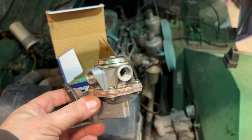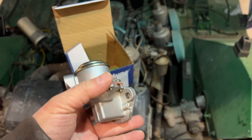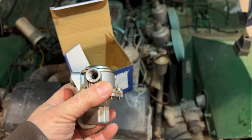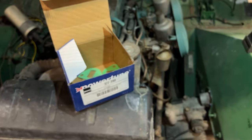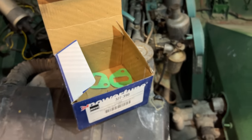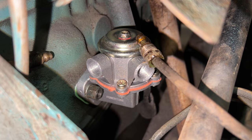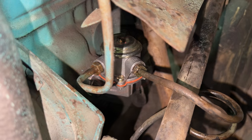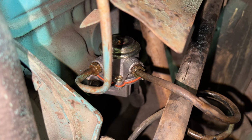Here's the new fuel pump. These do not come with a priming lever like the original pumps for these cars did, but other than that they look pretty similar to the original. Pretty simple to install — just put the gasket on and bolt it back up. The new fuel pump is installed and now I can connect the fuel pipes. The fuel lines are connected back up, so now I can put fuel into the tank.